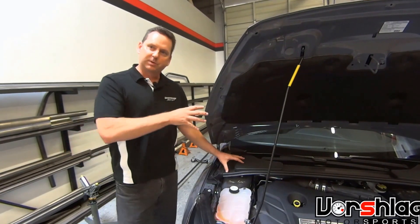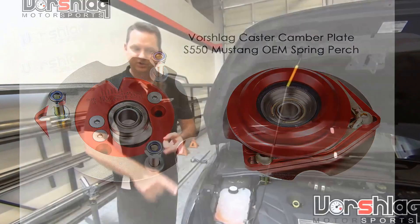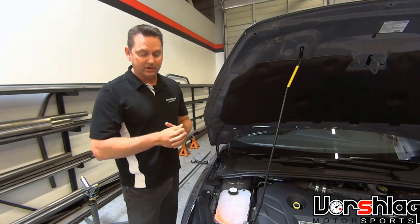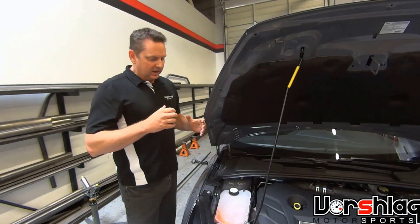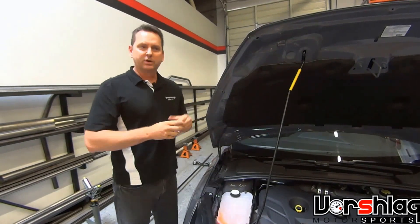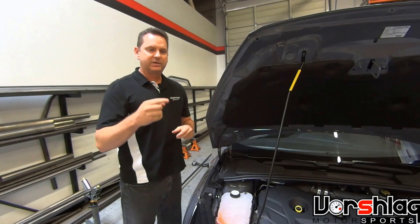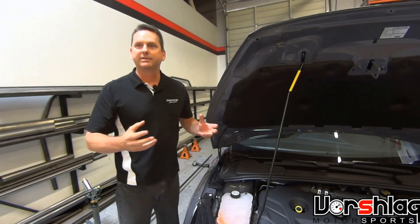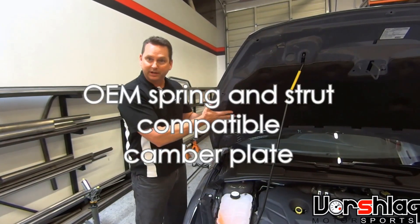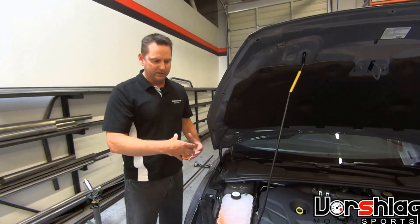Initially, when a car first comes out, we like to make a camber plate that works with the OEM spring — like we did for the S550 Mustang, Camaro, and the F22 BMW 1/2/3/4 series, which is coming out in the next couple weeks. When we released the S550 camber plate for coilovers a year ago, we sold three or four sets. We released the OEM production version middle of last week and sold nine or ten sets in a week. So the OEM version, when a car is brand new like this is, is much preferred because we can still work with a factory spring, a lowering spring, and the stock shocks.